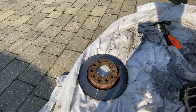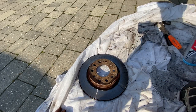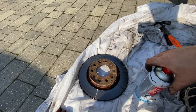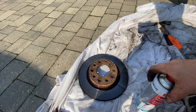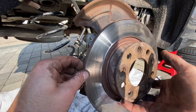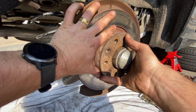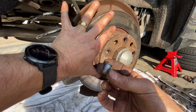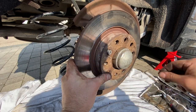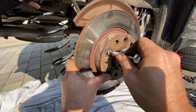If you were replacing your discs, now would be the time to give them a clean over to get that protective film off that they put on to stop them corroding. Just wash over with some brake cleaner, a wipe over with a tissue both sides, and that'll get them ready to go on. Once everything's clean, offer the new disc up, lining up the holes for the wheel studs, then get your small fixing and pop that back in with your 5mm allen key.